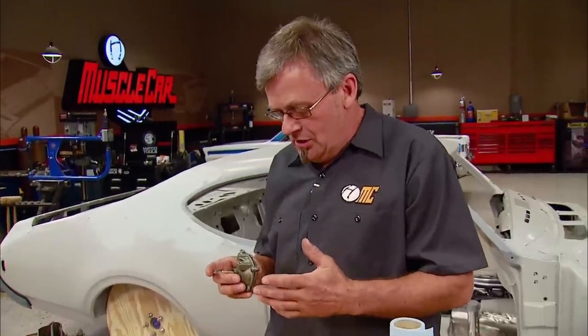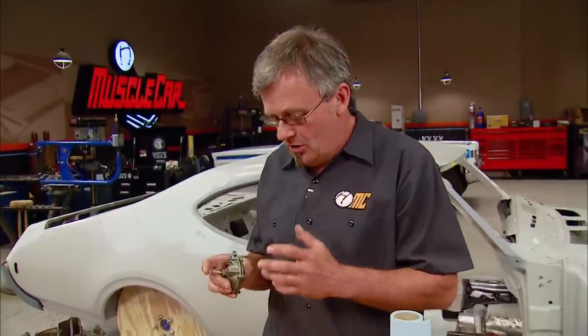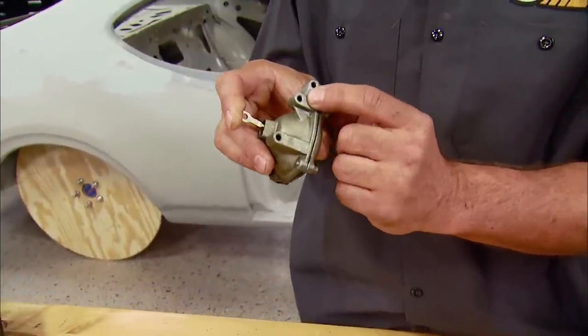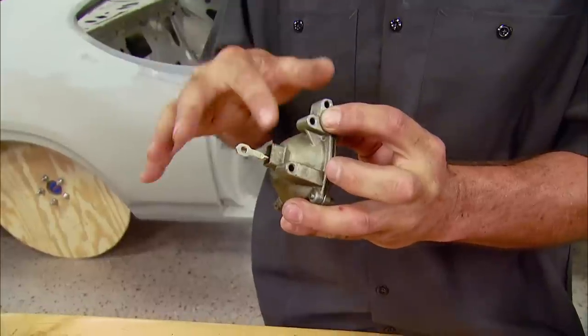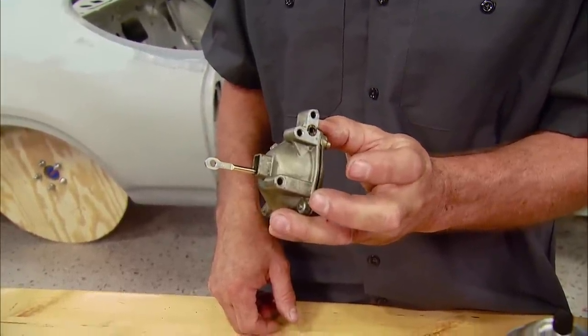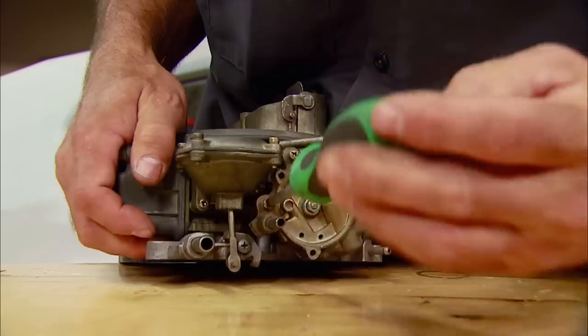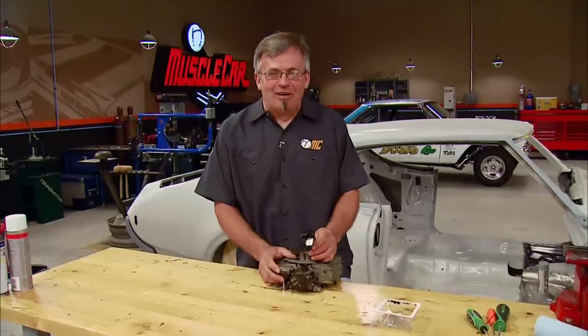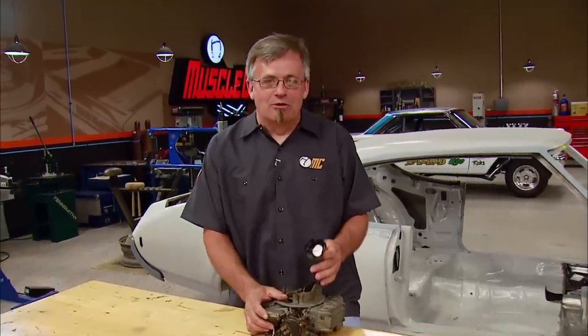There's a simple test to make sure it's going to work properly before we put it back on the carburetor. All you need to do is compress the rod in the housing and put your finger over the vacuum port in the center of the diaphragm assembly. Let go of the rod and see if it stays — if it stays, that means there is a vacuum and you have a good seal. Then let it go and see if the rod operates as it should. Most people would go through the trouble to rebuild the complete carburetor and neglect this one component. This one $10 piece, when changed, can make a huge difference in your carburetor's performance and is well worth the money.